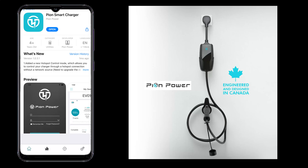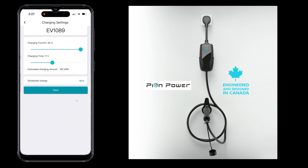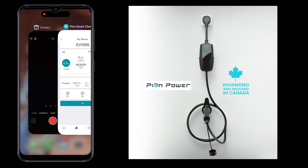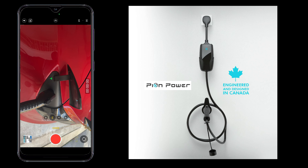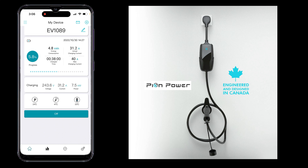Now let's talk about the app — it's called Pion Smart Charger. Inside the interface, the first thing you can do is start charging. When you hit the stop button, it asks if you want to adjust the current and time for charging. If you need to limit to, say, 8 amps so your breakers don't flip — especially with a crowded outlet — you can do that by dragging the amp slider. While charging, you can see the charge time used, kilowatt hour, current, voltage, power, charger temperature, and much more.